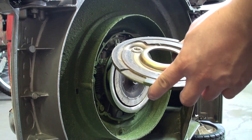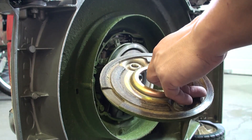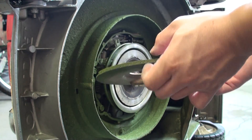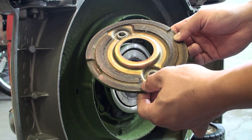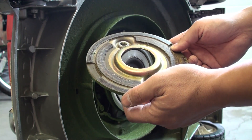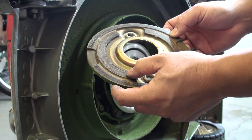Examining our driven disc, we need to determine whether it's completely worn down. Judging by the appearance it looks like this clutch is suffering a case of glazing on the clutch surfaces rather than wear. According to factory spec, the service limit is 4.6mm for the brake — the outer portion — and the inner clutch that drives the blade. When I measure with calipers I've actually got about 5.1mm, which is lots of material left. I bought a new driven disc and it's actually the same spec as a new one.